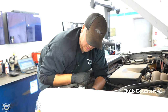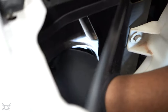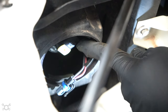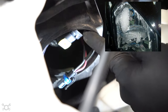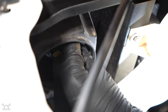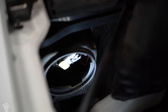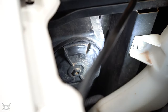I'll go ahead and put this bulb back in to show you the process. You're going to put it in the same orientation with the connector facing up, apply some inward pressure, and turn it to lock it into place. Make sure the bulb looks like it's sitting in there properly with all the tabs seated underneath — if you get it in crooked, the heat can melt the housing. Then take the connector, line it up with the locking tab, and lock it in; you'll physically hear a click. Reinstall the cover and turn it all the way until it stops so the unit is sealed.